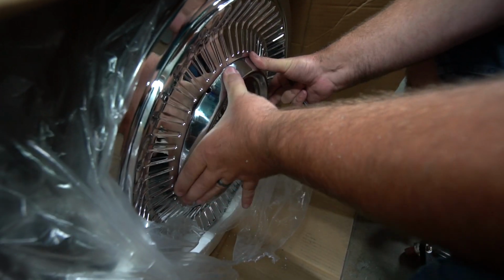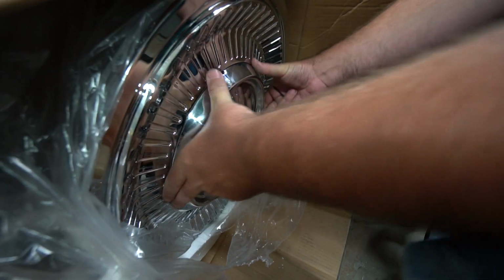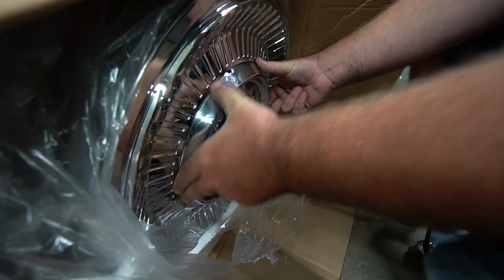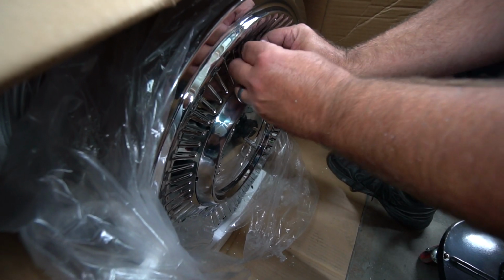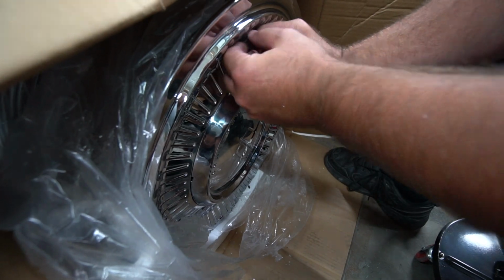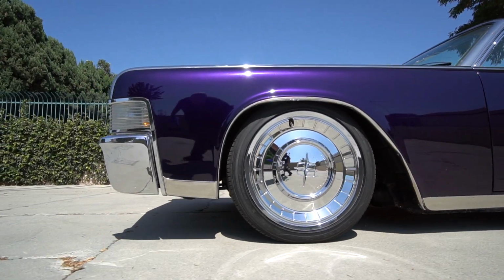When the cap is hand tightened, the hole on the notch should line up with the set screw. You can verify with the flashlight that the hole behind the notch is directly above the set screw. Use the provided Allen wrench at this point to tighten the set screw.